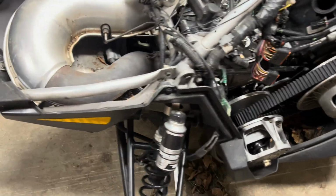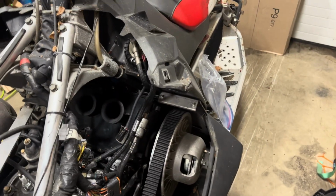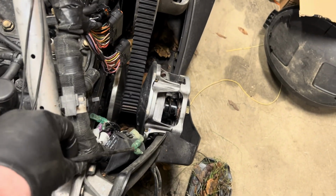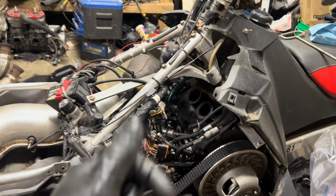Okay, exhaust is all in. I'm feeling confident when I put all the springs on it. So now I'm gonna go ahead and throw the air box and all that on, hook up my plugs, run through some of the wiring, get the exhaust sensor and all that plugged in. I'm gonna put the oil bottle with the ECU and all that stuff on, plugged in. Progress.